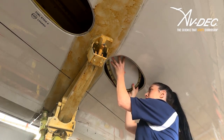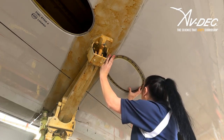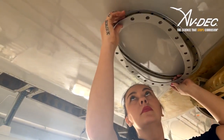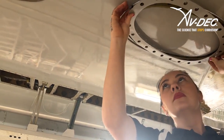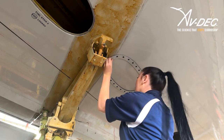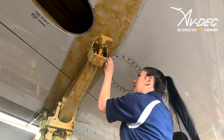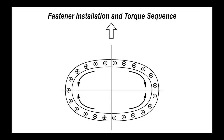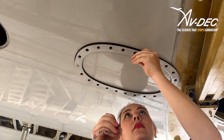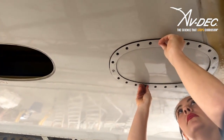Place the fuel tank access door in the opening of the fuel tank. Place and hold the gasket and clamp ring in the opening of the fuel tank. Make sure the gasket is correctly installed between the outer face of the door and the wing skin. Install the mounting bolts in the clamp ring and gasket, then hand tighten to ensure proper alignment.